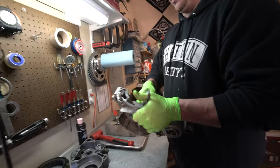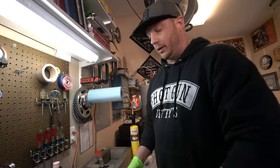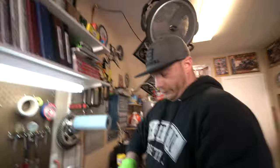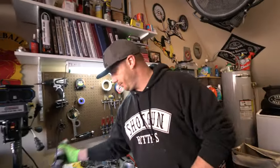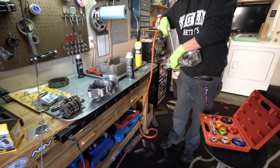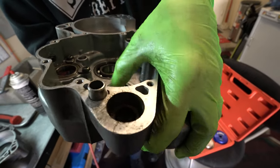There are a lot of things I look for when buying a used motorcycle. If it's in parts, I've seen guys rip them apart and give up because it's overwhelming. You think you're getting a good deal for $500 until you realize you need a $2,000 head for a four-stroke, or new cases — it starts adding up real quick. So yeah, this one feels notchy. It's got either debris or a bad bearing. Hopefully it's not a bad bearing because then we'll have to replace it. It's feeling pretty poor.